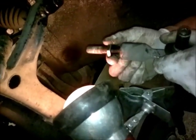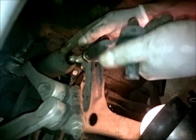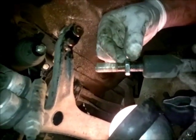Once I've got it out - before I take it out - what I do once I crack that nut is screw it backwards until it just touches against the edge, so it's right back where it should be, and then I start unscrewing it. When you unscrew it, you can count the number of turns before it comes out. So when you put it back you count the same amount of turns until it gets back to where it's supposed to be.